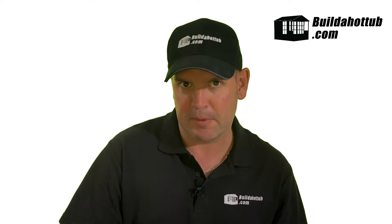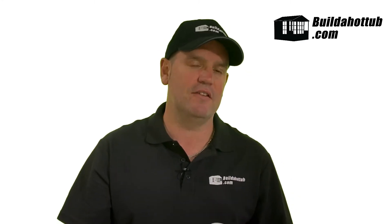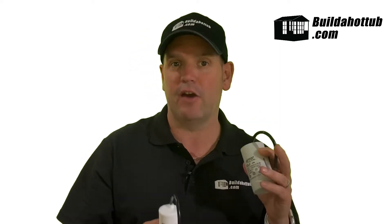These two have different roles. The larger of the two is the startup capacitor, and what this does is it helps your pump actually turn. So when it gets its initial charge, the rotor moves around, and then the capacitor helps it get over the arc to do the complete revolution inside of the pump. It needs quite a large capacitor to actually get going, so this is why we have the startup capacitor.